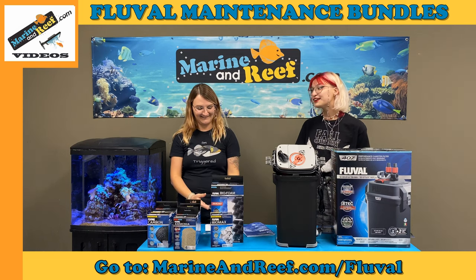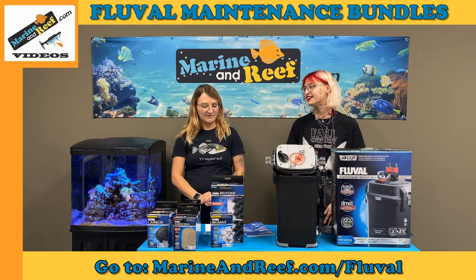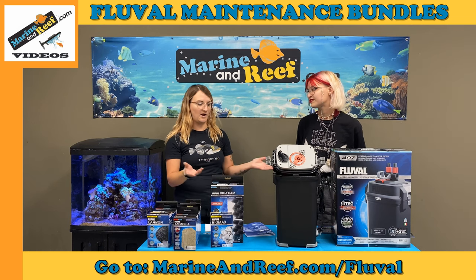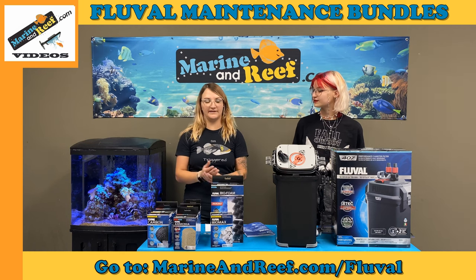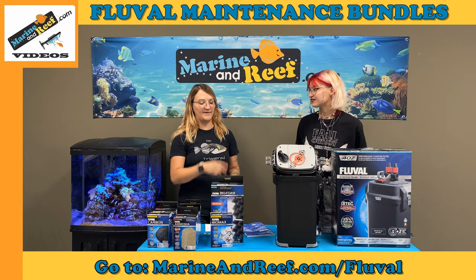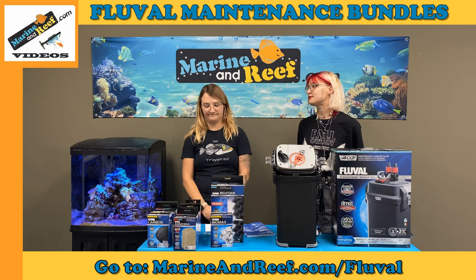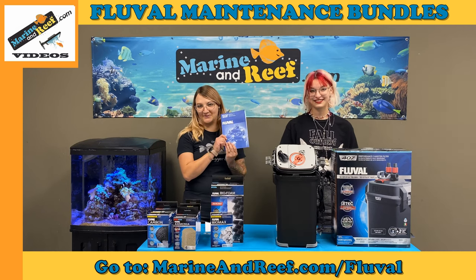But they didn't even look broken or used — why would I replace them if they're not broken yet? Well, if the seal happens to fail, your filter will leak and water will end up all over the floor. If the impeller breaks and fails, there will be no more flow to the aquarium and all the bacteria will die, and your fish will die within 12 to 24 hours. So this is preventing those disasters — correct, yes. Recommended in the manual.